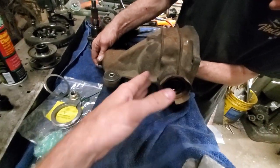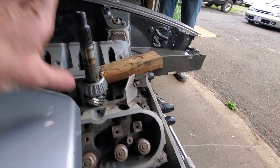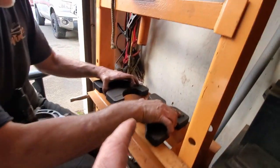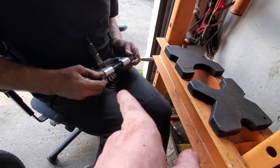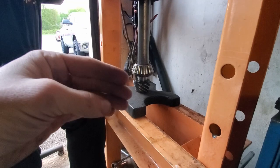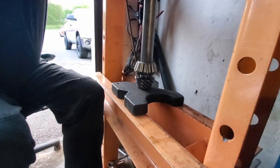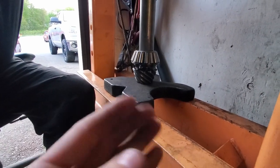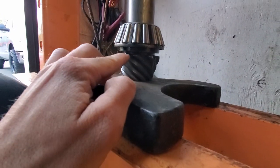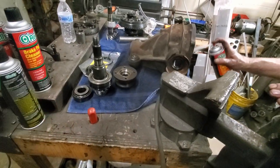What we found out is on this spindle here - this bearing goes to the 4.9 gear ratio, but this bearing is too small for my diff housing. So what we have to do is press the old bearing from the 4.08 gear ratio and press it onto this, after taking that one off. So now we're pressing the bearing on - the older bearing that was in the 4.08 onto the 4.9 spindle. We're pressing that down to where it bottoms out, and there is a shim under the bearing between these two pieces.